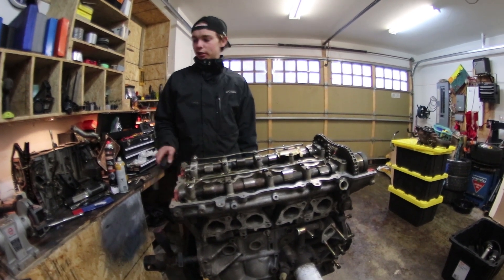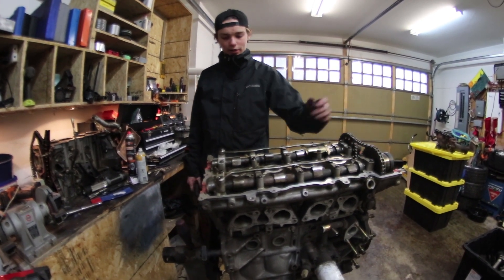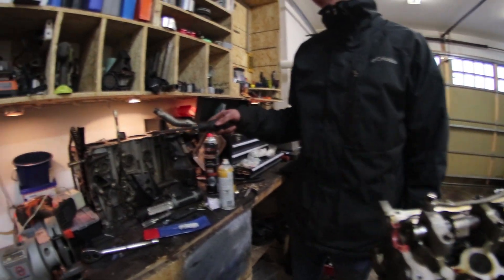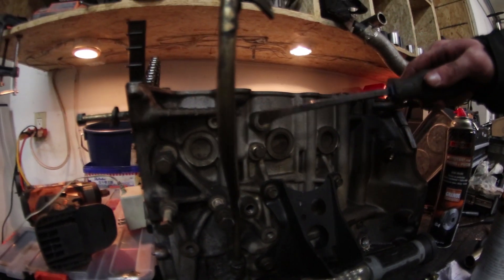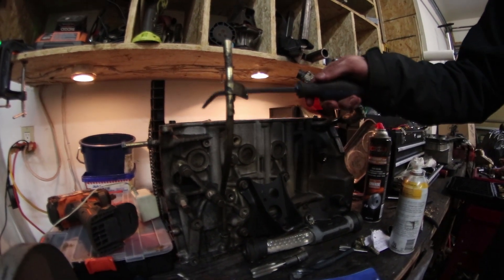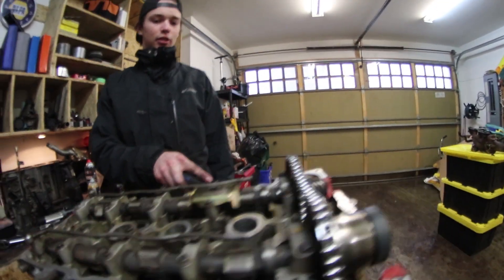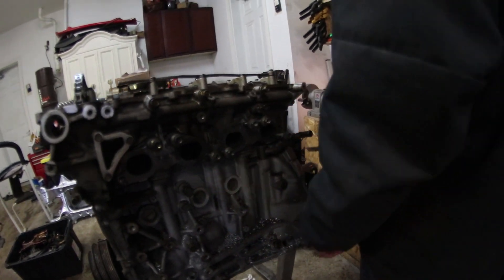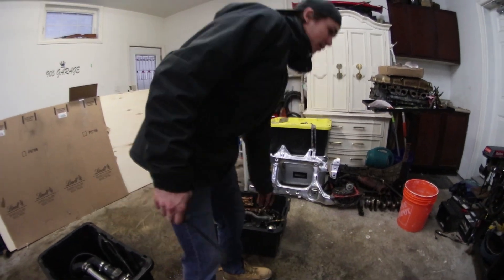It's a NA S15 SR and this is an S14 - they're both notch top so the parts should pretty much all fit. The main differences you have to focus on are the oil drain, the oil feed, and the coolant line to the turbo. There's also one that goes into the water outlet, but you just switch water necks because it has the fitting for the line already on it, so you just switch it over from your old motor.